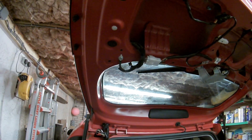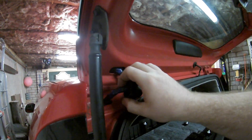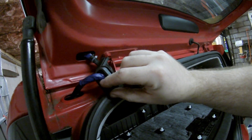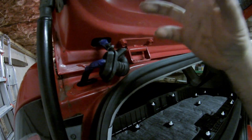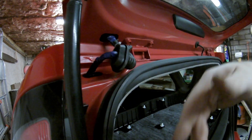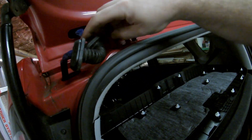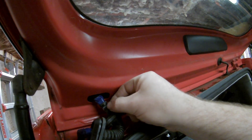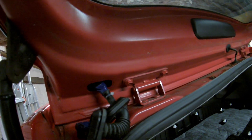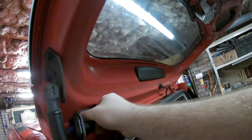Now to cover that back up in tape and close all this up — easier said than done. I put a layer of tape over that connector to insulate it from the other wires, then moved all the wires so they laid flat and neat against each other. I started from the bottom and worked my way up, got as high as I could, slid the rubber back down so I could finish it all the way up. Then I put the cable tie back around the rubber boot to stop the cables from sliding, and then you can just push the rubber grommets back in.